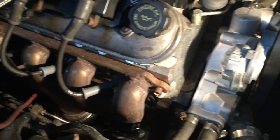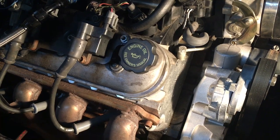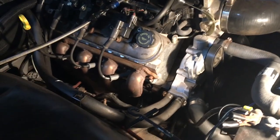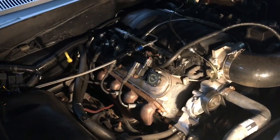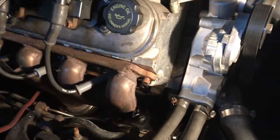There's basically a 3/16-inch spacer under the frame mount, and that jacks up the motor enough so that I can use the '99-plus LS1 Camaro-style oil pan. I also notched the frame just a little bit on each side of the crossmember, and that — in combination with putting spacers under the motor mounts — allowed me to get the motor up enough so it didn't hit the frame.